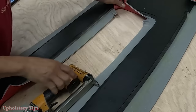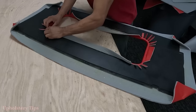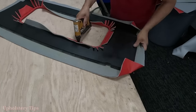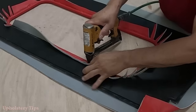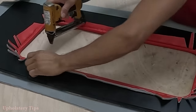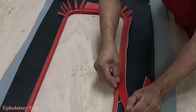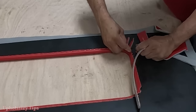Same thing right here — I pull it and staple. Pull and staple all around. Now you can see why I didn't staple all the way around the outside first — because I'm doing the inside first. I got it — no wrinkles on the front outside. Then I cut it evenly. Now that piece of vinyl is flush with the wood, nothing over the wood — flush.